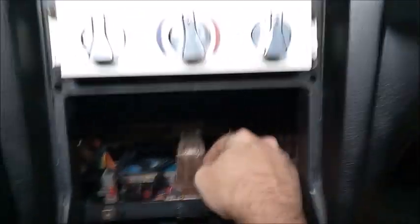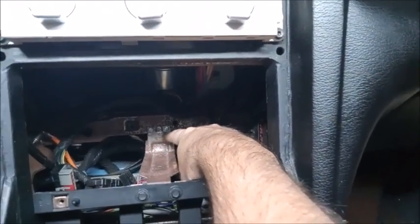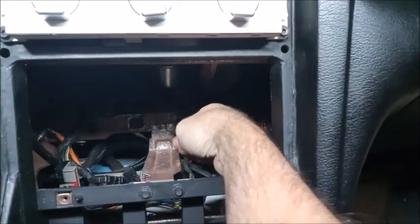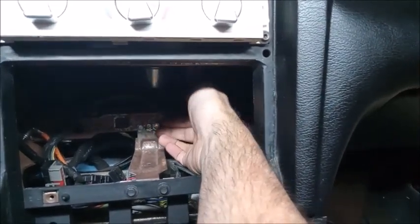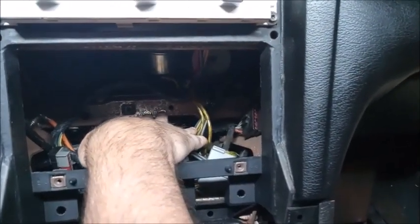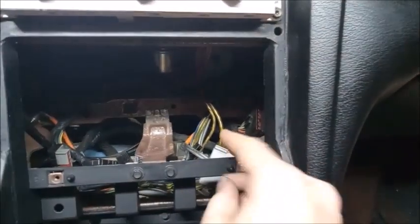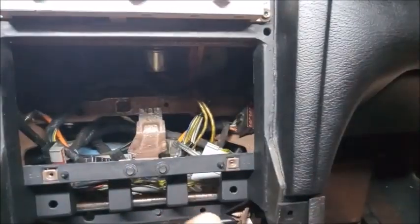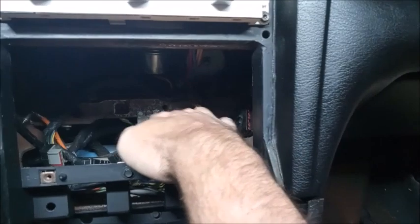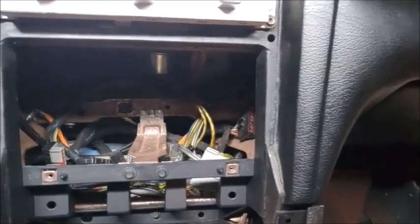And then this bracket here, this half inch right here, is how it is in the factory: the last half inch of it folds up and is spot welded, two spot welds, to the dash frame back there. They're a little different than this SN95 one. It's basically the same, but slightly higher. You could use a spot weld cutter on a drill.